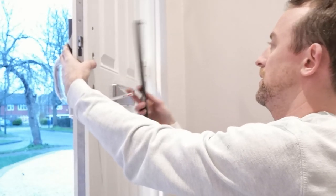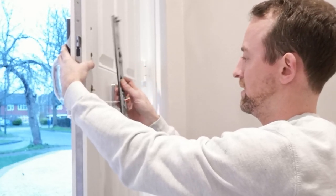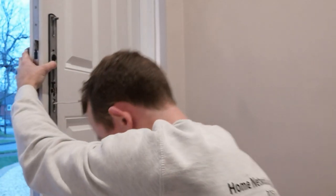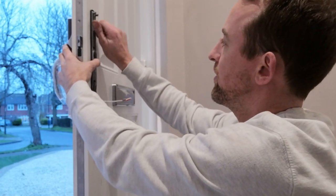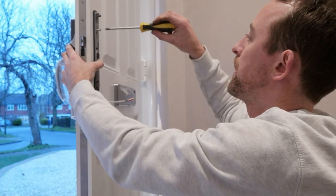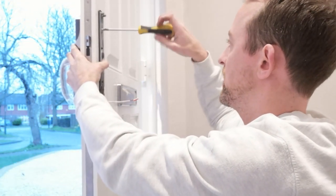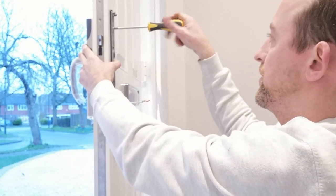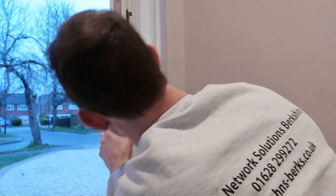Take the cover off and gently slide everything into place. Now that it's all lined up, get the screws from whichever was your relevant pack based on your door measurements and put these into position. Just loosely tighten them at the moment — don't make them too tight yet as you're going to have to play around with alignment in a minute.